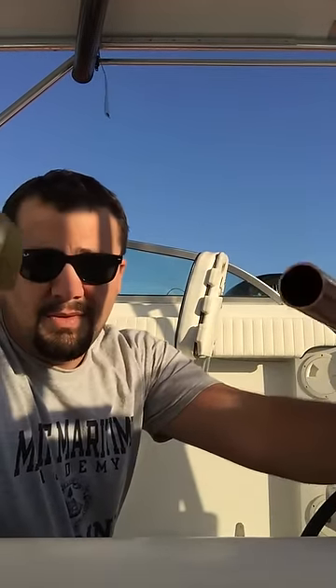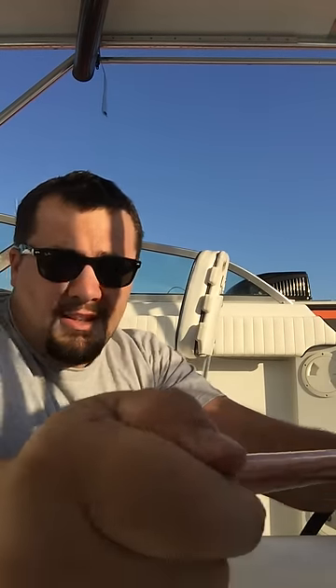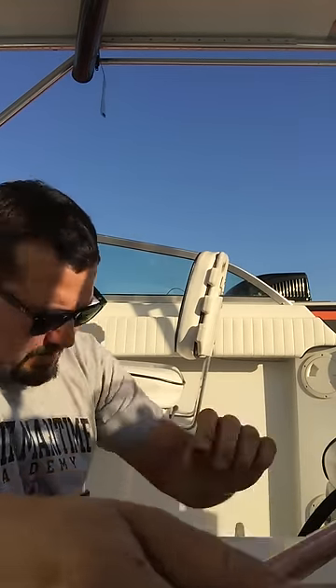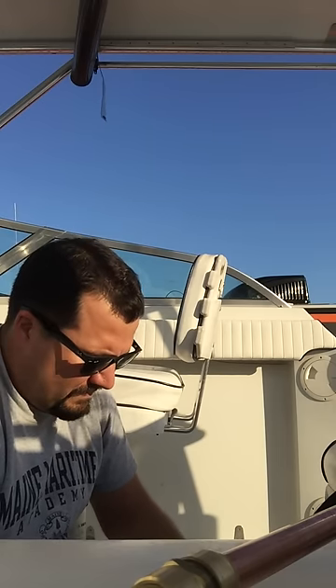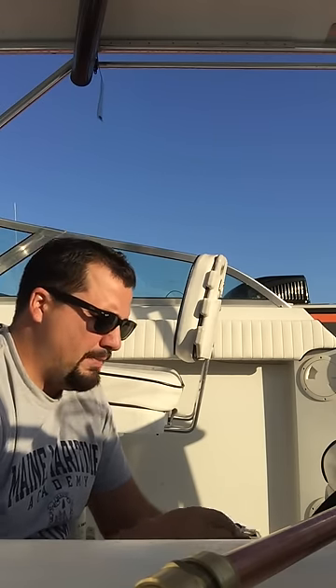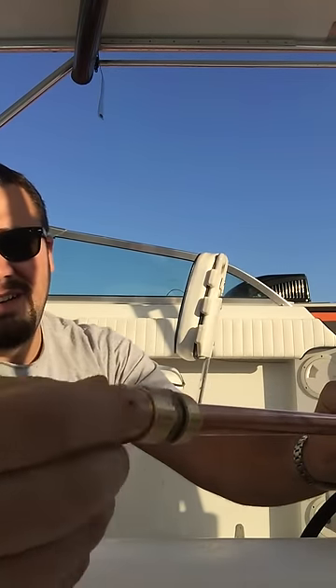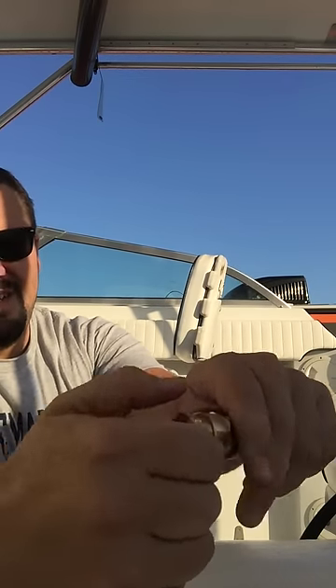Your snap connector — it's real simple. If any of you have ever done any home plumbing, you basically put it in the pipe and jam it in and it locks. That's set — it's not going to go anywhere, that's a good seal. The next thing, same thing at Home Depot: get a half-inch hose adapter or whatever size fuel pipe you have. Screw that in there and now you've made a good seal.